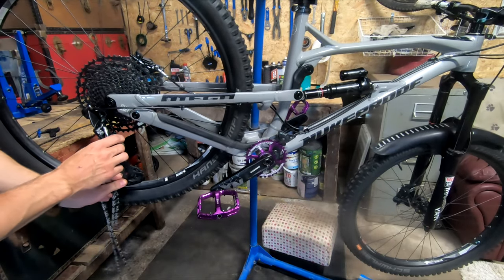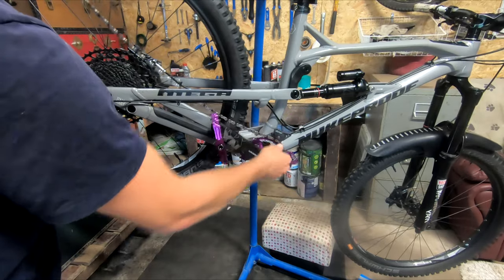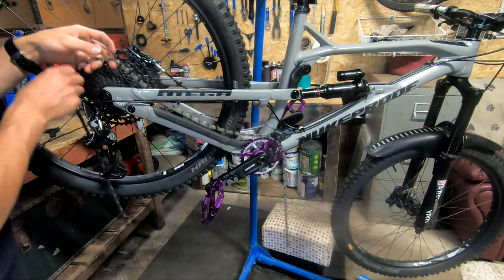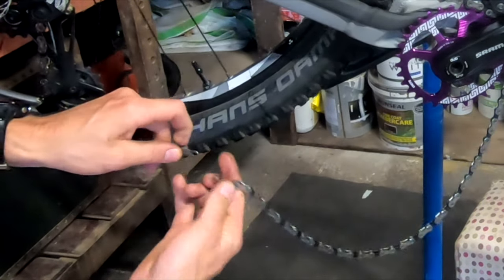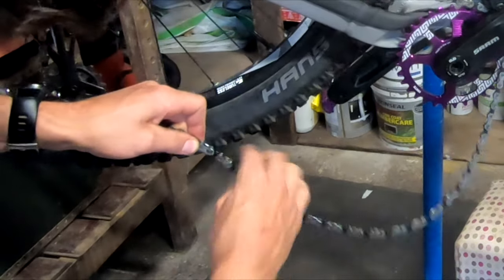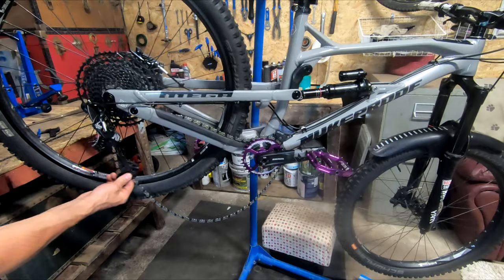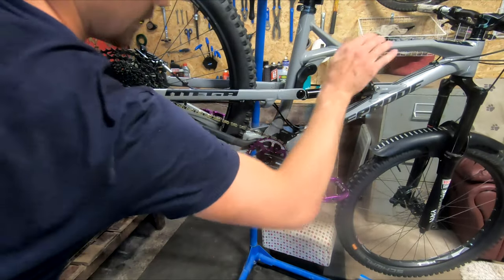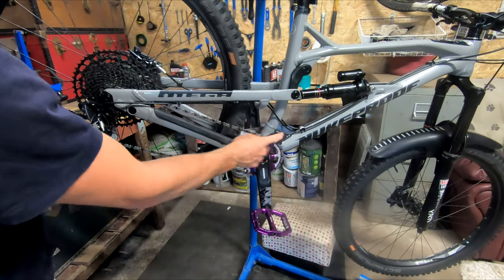Put the chain back on - pull down your rear derailleur, push in the lock so it stays down. Thread it through the frame, onto the chainring - force it on there, get it on the teeth, sitting nice. Thread it through the derailleur onto the cog, through the back of the derailleur. Get the two split link pieces, one either side of the chain, push it together so they click in. Pull it a little bit - it won't lock in just yet. Get the split link around to the far side, put your pedal up there, give it a whack and that locks it in place nicely.